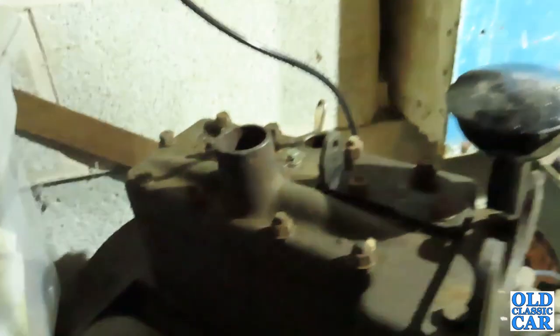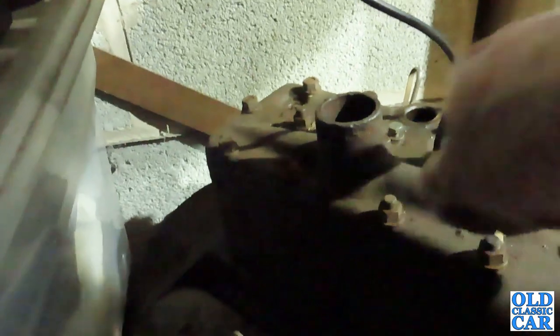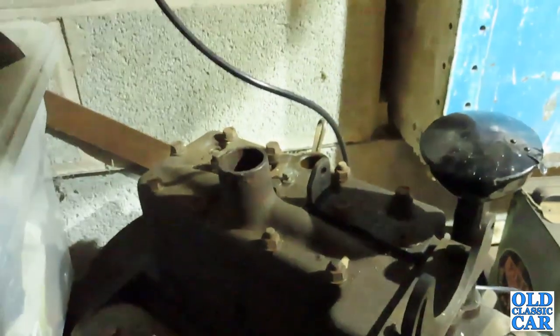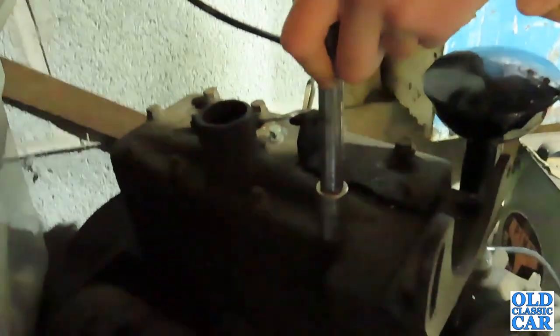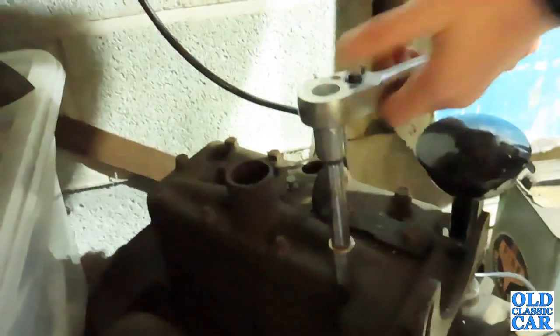Just loosening one, if you loosen that one off fully, and then this one off fully, and then this one off fully, you've got a risk of distorting. Even though it's cast iron, you can distort things. So the trick is probably start at the outside, those four, and then sort of work your way in and do about a quarter of a turn, something like that. Yeah, I do that when I'm doing carburettors, when you're putting the top back down on the carburettor.